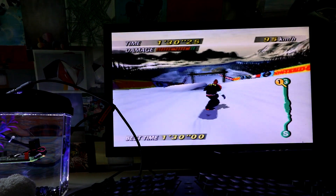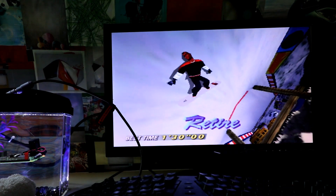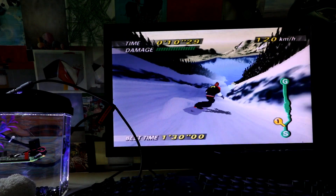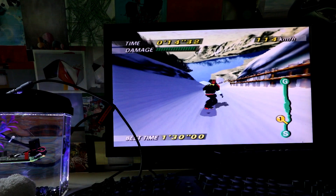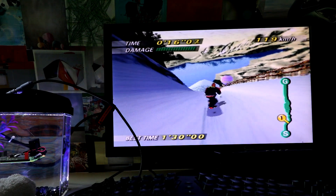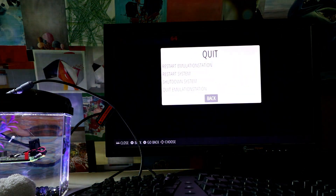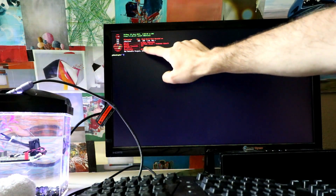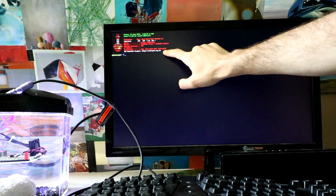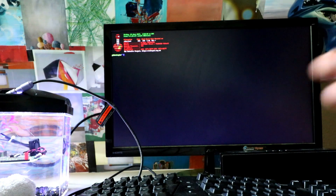Oh, I didn't even make it to the finish line — 1.35, 520, 525 megahertz on the SD RAM. We're going to do a quick quit and see what our clocks and temps are. We're only at 100 degrees Fahrenheit on the CPU and 102 degrees Fahrenheit on the GPU. Totally low! It doesn't want to freeze, guys. So there you go — let's play another Nintendo 64 game.